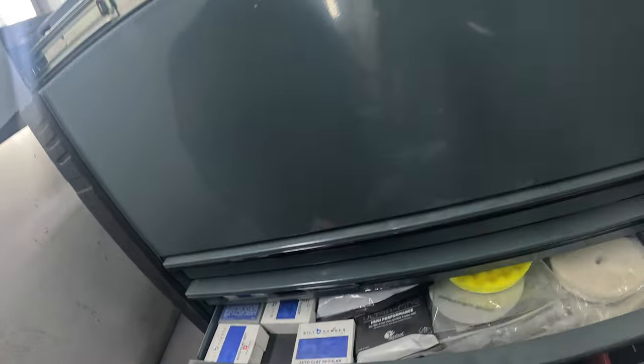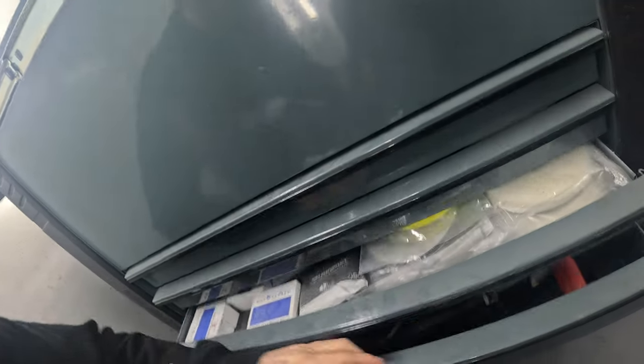But yeah, this is what I polish it with and sand it with. All the sanding products would be 3M Trizac, the discs and everything, and any production paper that I might use. So I use a heavy cut rotary with Koch-Chemie heavy cut compound, and a Koch-Chemie heavy cut pad, a couple of sizes, probably the medium and the large, and that'd be done with a Rupes rotary polisher.